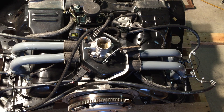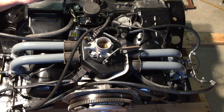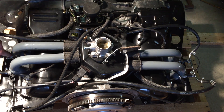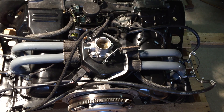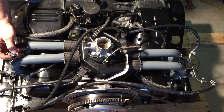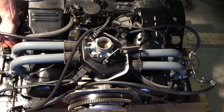You don't have to mount the regulator there either — you can run that return line and put the regulator where the manifold pressure sensor used to go; that might be a good place. You've got four new injectors with adapters — they're the Bosch EV-14s. The wiring connectors all have a little embossed cylinder number so that keeps everything straight when you look up close.